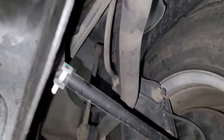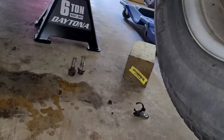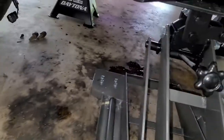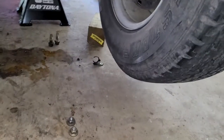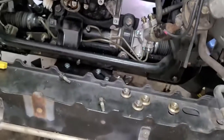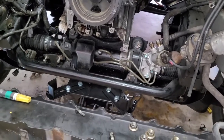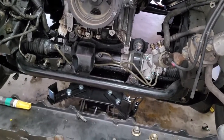All right, so my bolts for the subframe are buzzed off up here, buzzed off back there. So you should have 8 bolts total. Well, 4 nuts and 4 bolts. All right, so the only thing to do now is to lower the subframe. I need both hands and concentration for this, so I'm going to stop the video and it'll be lowered in the next clip.